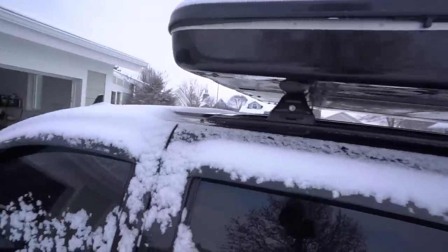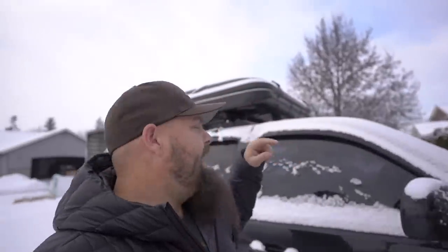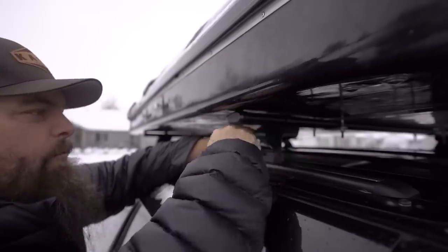In hindsight, it was a mistake to mount the crossbars to the roof tent. I thought I was saving myself extra work because last time I couldn't access the bolts to tighten the brackets — it was a huge pain. But these particular crossbars give me enough room to easily loosen and tighten the bolts, so that wouldn't have been a problem. The real problem was that I just didn't measure right — it was a huge pain, and that was my fault, user error. The right way to do it is to put the crossbars on, get the tent up there, and then put the brackets on last.